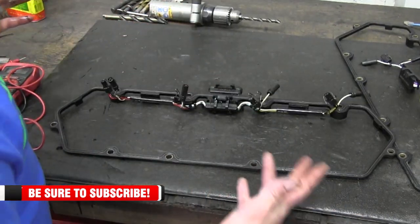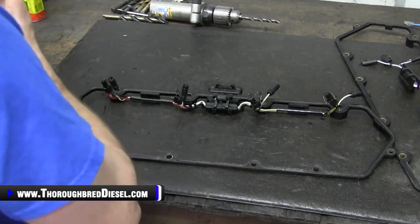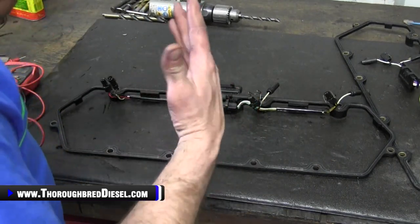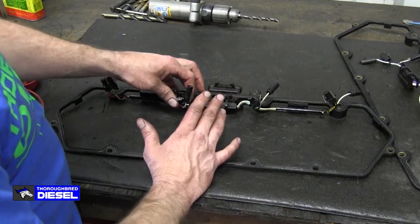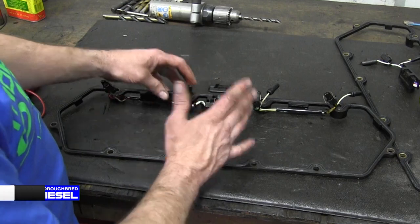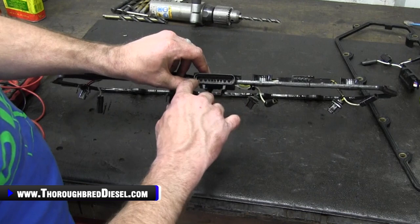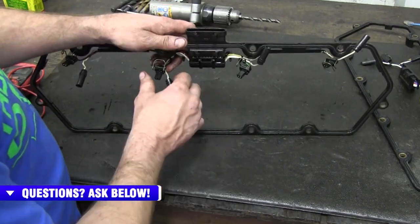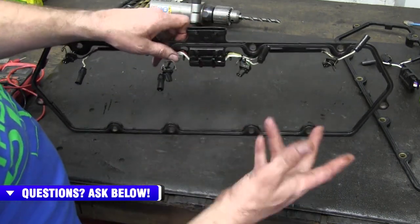That's just a little bit about looking at the valve cover if you're doing some testing, and it can get a little bit more complicated than that. You want to make sure with your probing that you don't — for lack of a better term — waller out one of these ends to where it doesn't make a good connection with the injector at that time. You can also test the glow plug side. If you look through here, the larger of the spades are the glow plug supply because it runs a higher wattage, so they're the thicker of the spades — those four will be in there. And that's separating the internal harness from the external valve cover harness.